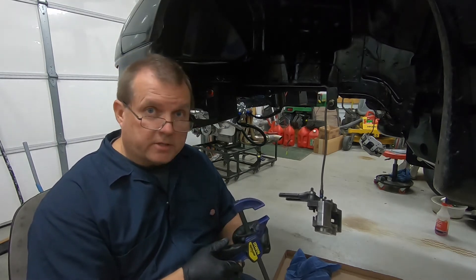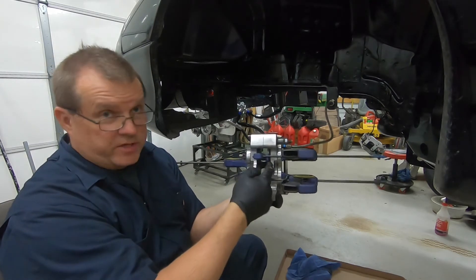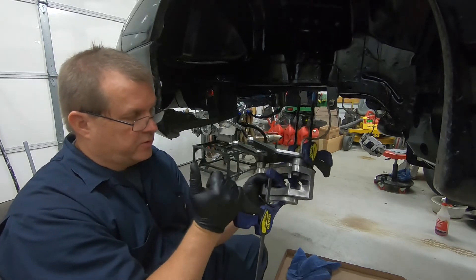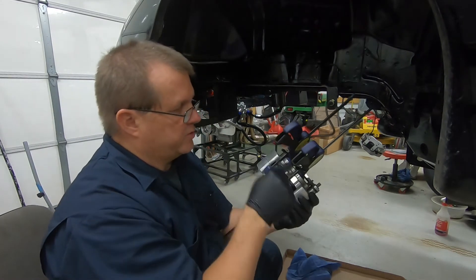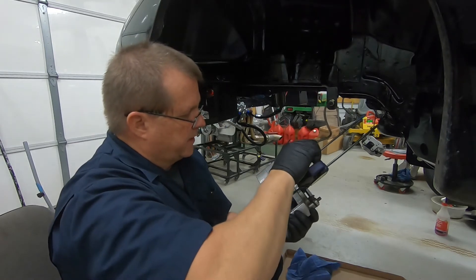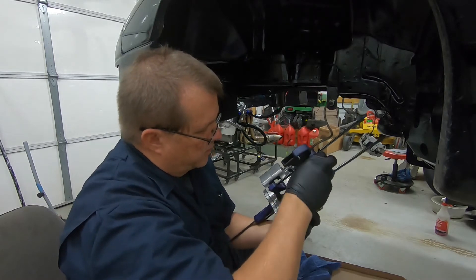What I did here — I got two clamps, one on each of these pucks on this side of the caliper, and on the back side I got one clamp holding two pucks in place so they don't move. I basically split between the two to keep them clamped down. I'm going to start compressing each one of these pucks one at a time. Sometimes you can alternate between each side and they'll start to move. You might have to readjust to get centered up on that puck.